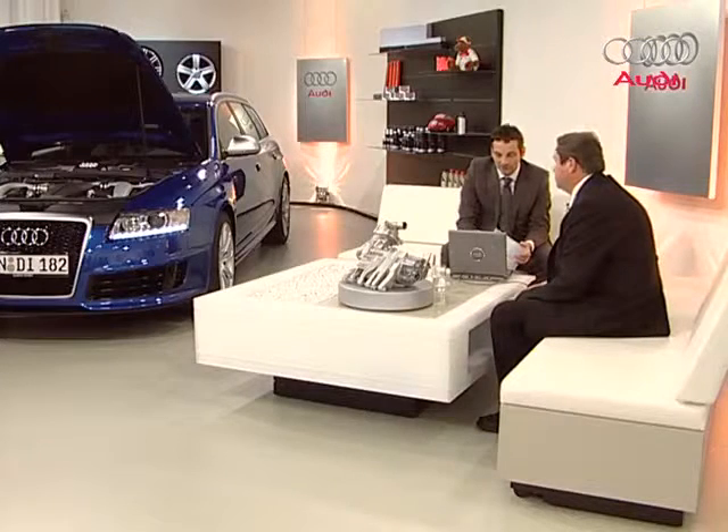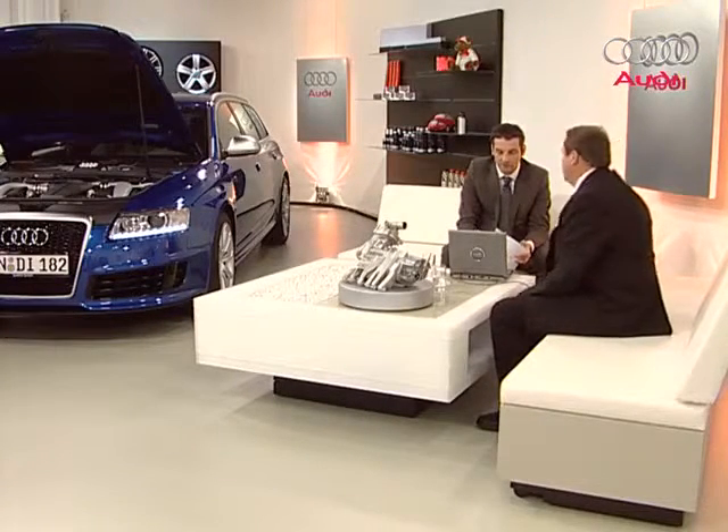Holger Bensing asks: how are the crankcase breather gases warmed when the engine is cold, since the coolant would also be cold? When the engine is cold, there's no icing up because there isn't enough flow rate yet. But as soon as the engine has been running for a few minutes, heat comes from the cylinder head — the hottest part, situated above the combustion chamber. You'll see two banjo bolts linked by steel tubes going to the crankcase breather inlet on the intake manifold. Temperature builds up quickly, starting very early, before you even notice heat inside the vehicle. So it's not a problem for very short journeys either.